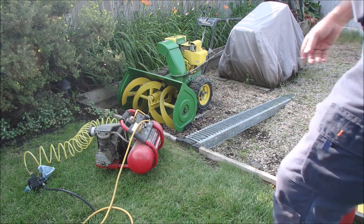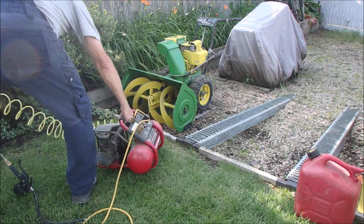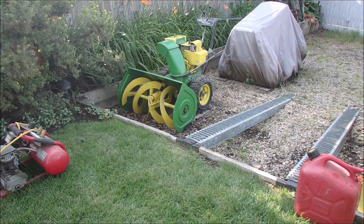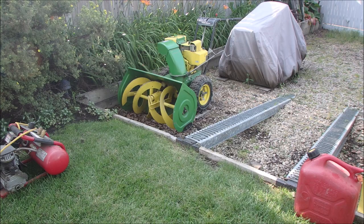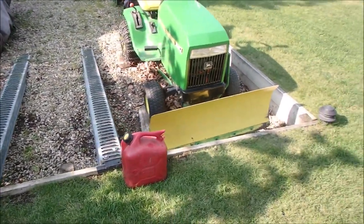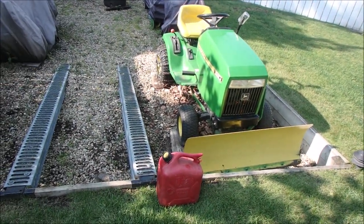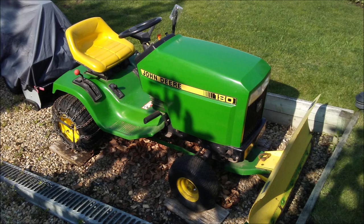All right, my friends. This is the old one. As far as I could tell, it's a 1974. It has points. I've just wiped it down, got the dust off it. Put 30 pounds of air in the tires. There was about 10. And in that one, there was about 3 pounds of air in each tire, and I put them to 10 in the back and 12 in the front, because it's going to sit a bit more before I use it.